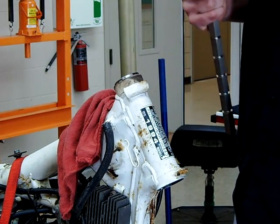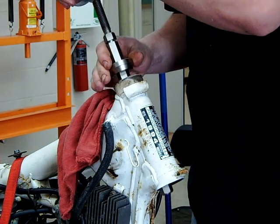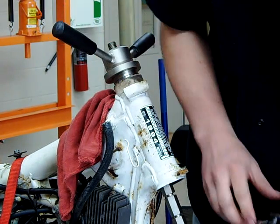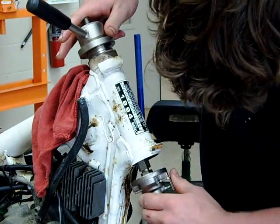Okay, we're back here, and we're starting to get set up on the bike here. So I've kind of went over which way the race needs to face, and he's got some grease on there too, so it doesn't scratch it as he pulls it in. And what he's going to do is he's also going to be trying to be conscious about keeping it nice and centered in the chassis there. You'll see in a second.